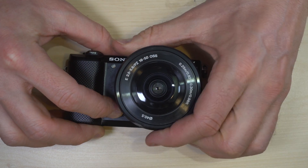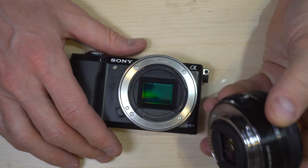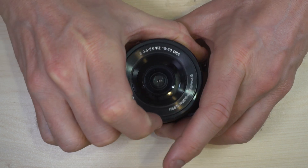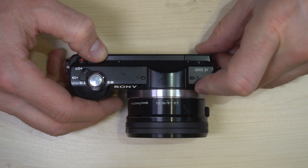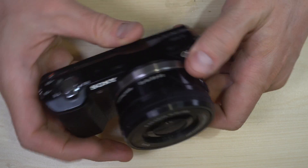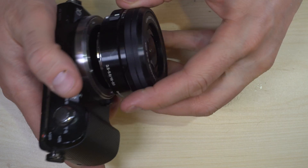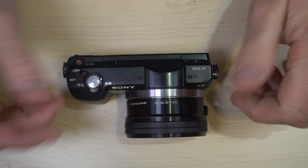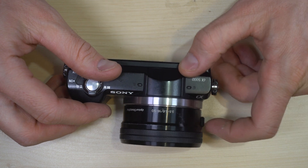Some things not to do with the camera: don't put your fingers directly on the sensor, because fingerprints are very, very hard to clean off sensors. Don't leave it in your car — it would be a theft target, and the heat and cold can also damage your camera significantly. Remember that even though the camera itself is lightweight, the lens isn't necessarily going to be, so if you drop it with a heavy lens the camera can definitely suffer. And don't let it get wet because it's not sealed, and water getting inside will absolutely wreak havoc on the electronics.